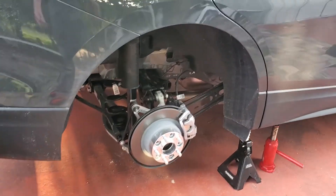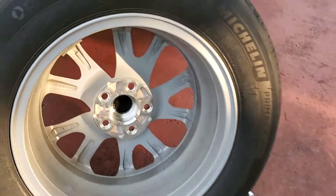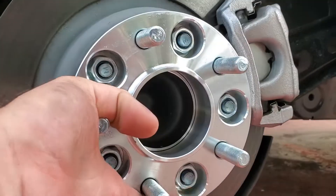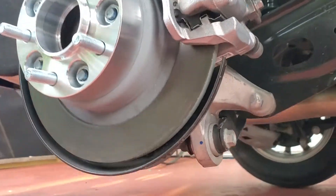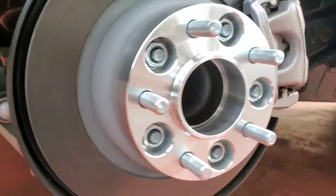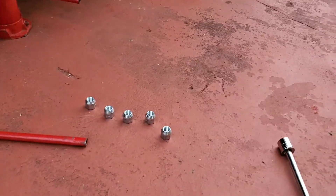This is the third tire I'm checking — right side, rear tire. Everything okay with the inner part of the rim. The spacer is in place, no cracks, no defects. A little bit dirty because of the rain here in Miami lately. Everything okay — looks formidable. Studs in place, sturdy. Bolts are okay. So far everything is all right.